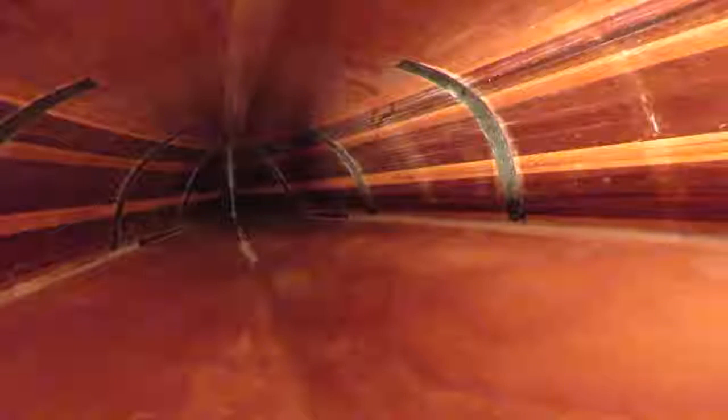Up in the very front, beyond where we can reach for the fillet, we'll do a liquid epoxy fill up there, both on the center line and on the sides, where we'll just tip the boat on its edge, pour the epoxy into the edge where the fillet is, and then let it run down along that joint and seal up on the inside. And we'll do that on the center line too.